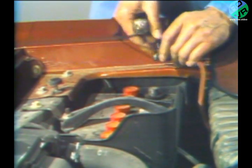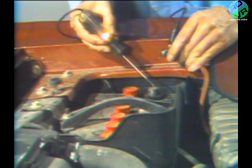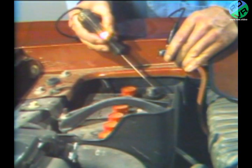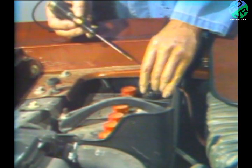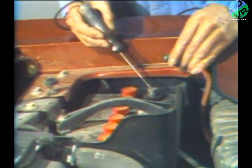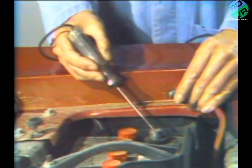We can most quickly confirm or rule out a short circuit as the possible cause. Simply disconnect the positive battery cable and jump the connection with a test light. If the light comes on, indicating a power drain, it may only be the car's clock winding mechanism. Reconnect the cable for an instant so the clock can wind and perform your test again. If the light does not light, and if there's not enough amperage drain to light this light, there's not enough to make the battery go dead overnight.